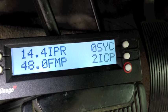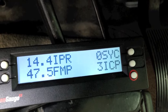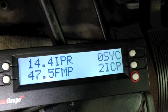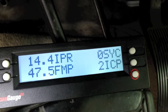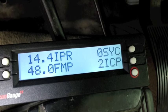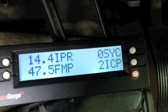Remember, we watch the FICM power during the injection clatter and verify the ICP is reading — we want to see it under atmospheric pressure, anywhere from 0 to 15 psi. If you have the new-style ICP sensor in an 03 or 04, they may read 50-60 psi; that's normal. I'm going to cycle the key and monitor FICM power during the injector clatter, then crank it and watch for sync, IPR, FICM power, and ICP buildup. Key on — injector clatter is good, we've got 48 volts.